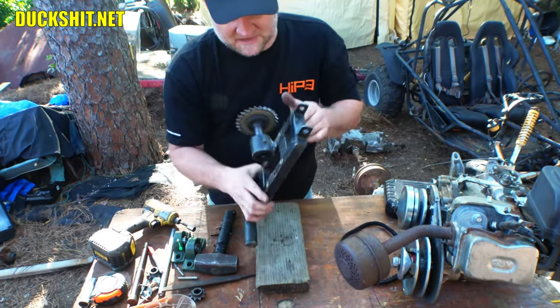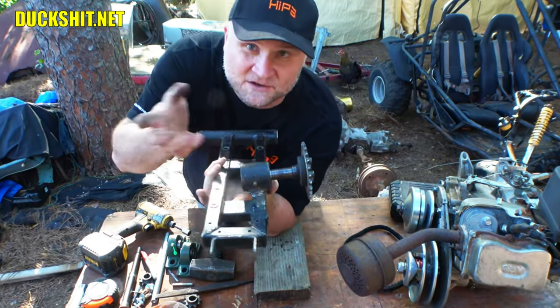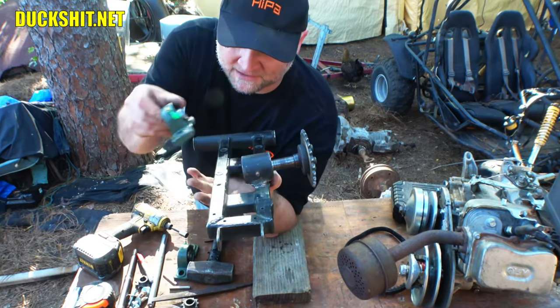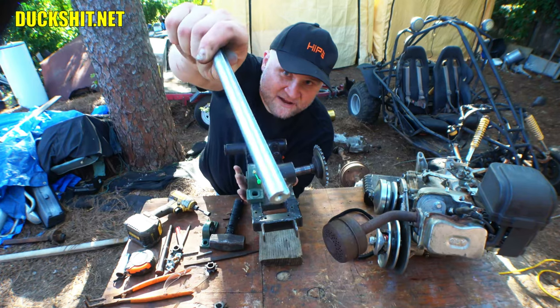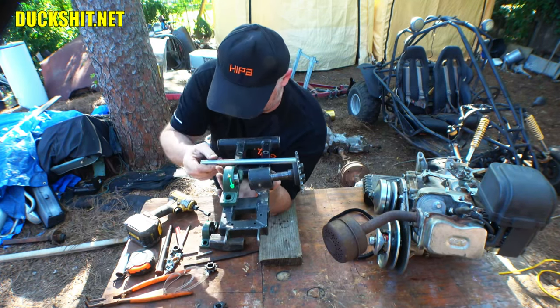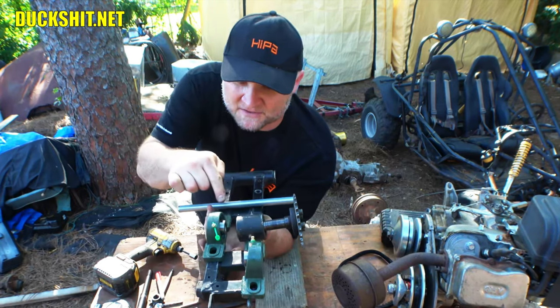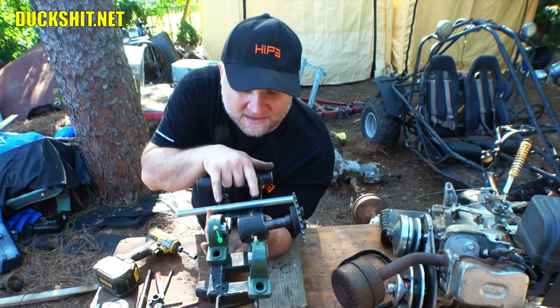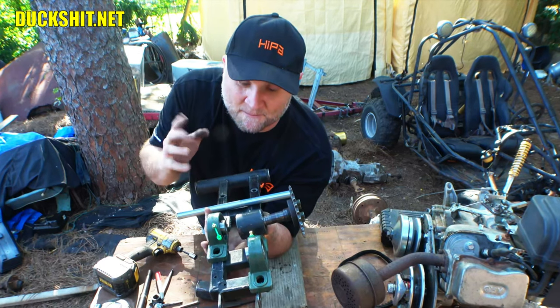But what we're going to do today is we're going to knock this stupid jackshaft barrel off of here. This thing's going to go away. And then we're going to use some pillow bearings. And what we'll use is a 5/8 inch keyed shaft, which will go through the pillow bearings. We're going to use two pillow bearings, and we're gonna mount them on either side so that way both rails take the full brunt, so it can't just twist one, it's gonna be forced to pull against them both.